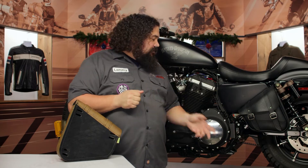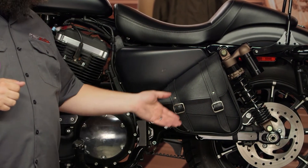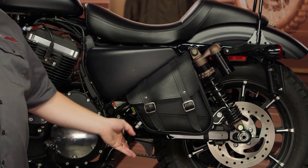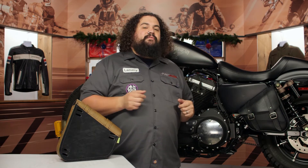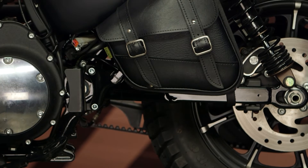A couple of items to note: firstly, you are gonna have to remove your passenger peg. It will not fold up, and even if it is out, the bag sits so far proud of the bike that your passenger isn't really gonna be able to effectively use that foot peg. Also, because this thing mounts to both the frame and the swing arm, it mounts in an area with moving components, so you do want to make sure there is a little bit of room back there.